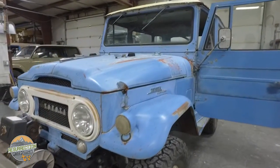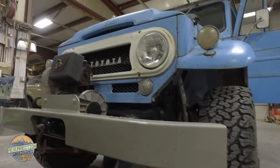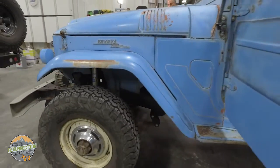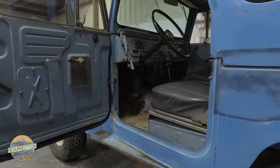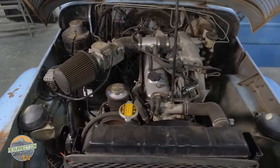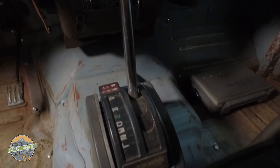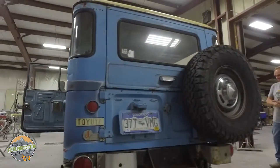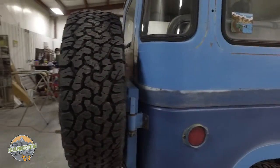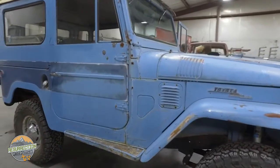James' rig is actually super sweet. It's a '67 FJ40 and it's got most of the original patina. We added our PRLC replica winch bar in the front, fixed all the rust in the back, and we're in the middle of trying to recreate the original patina. This rig has a pretty unique drivetrain — it's got a 3FE out of an FJ62 and also the A440 automatic out of the FJ62. Shackle reversal, power steering, disc brakes, automatic, a little more modern drivetrain — it's actually one of the more popular rigs we took to Cruiser Moab. This is why people love Toyota Land Cruisers.